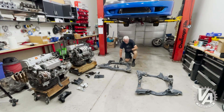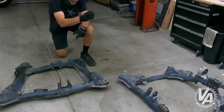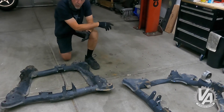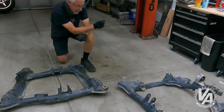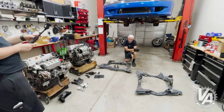If you look at the subframe, the big difference between these two is this rear bar. The rear bar is flat on the RSX, and it humps up on the regular engine. The regular engine, because it has a D17, has the header come out front, go underneath the engine, and go under the subframe — that's why it's like that. Unfortunately, that subframe is not placed in a position that makes it easy to do a swap header. If somebody made a swap header specific to the EM2 and ES2, you would actually be able to use a stock subframe. But as of right now, nobody's making a custom header, and it would probably wind up being kind of a one-off thing and rather expensive — not $250 like a lot of the headers available for K-Swap.